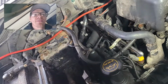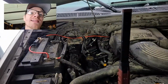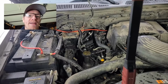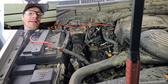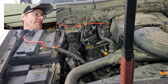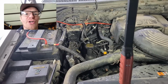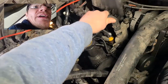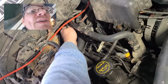But I don't have that right here. So we are at a standstill, but at least we know what it is and where it's at. This thing is clogged up, and if you got no flow coming out of the outlet, then obviously there's something going on. And I gave it a blow. That's the best thing I can do. I cleared it out, and we've made sure that there was some flow going back in there. But with the trickle going through, it's not adding up. And you can feel here that this line is feeling pretty decent, and this one's not so much.